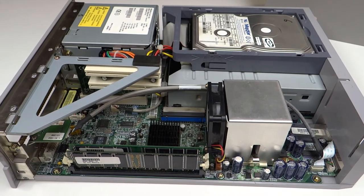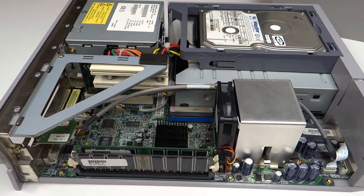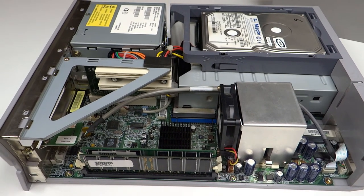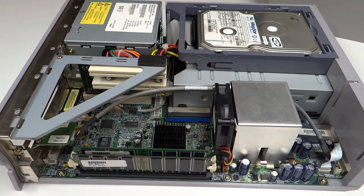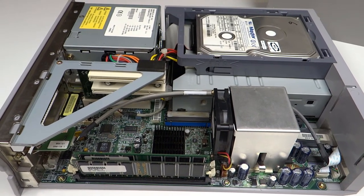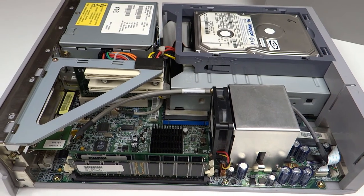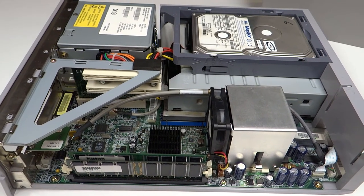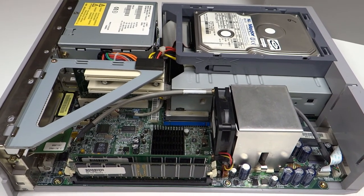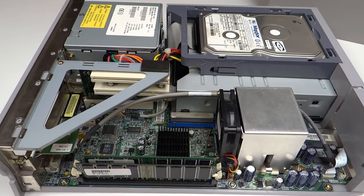Here's a closer look at what's inside the computer. When I first bought it, it worked fine - it all powered up okay, booted, did the POST test. But several uses later it was just switching straight back off again after turning on. Just pressing the power button and it would switch back off. I thought maybe the power supply was failing, possibly capacitors because at 20 years old capacitors do obviously start to fail.